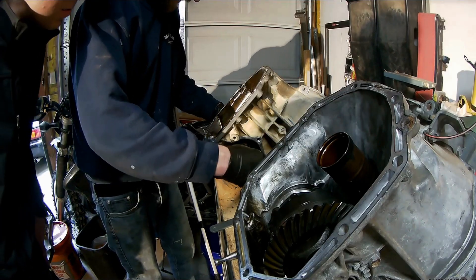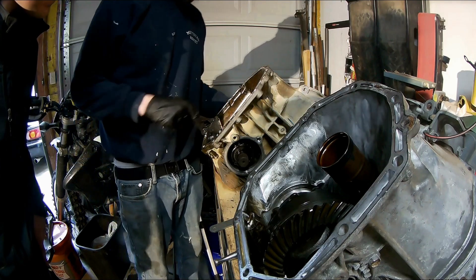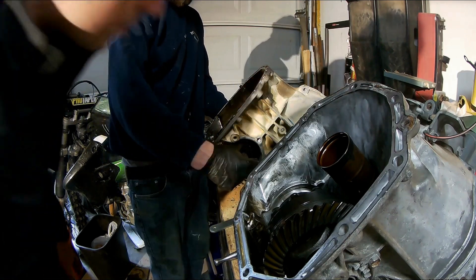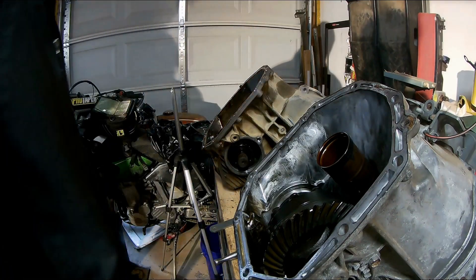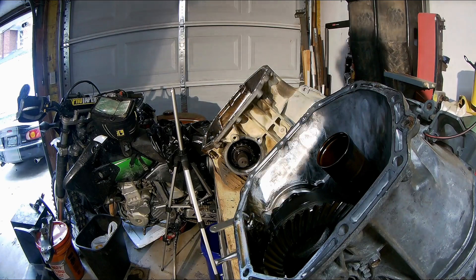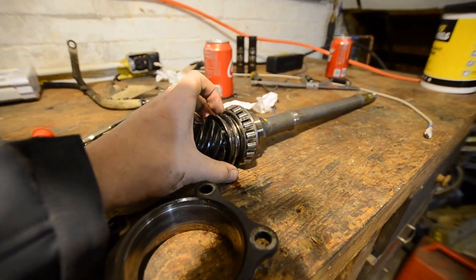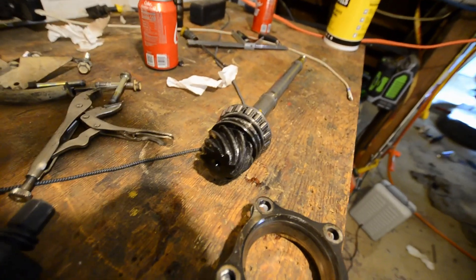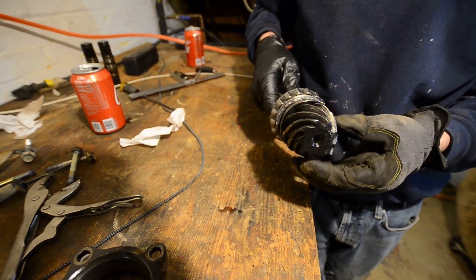Look at that - where did this come from? These are all intact; it must be the bearings for the pinion gear. I don't think there are bearings for the side gears - I think those are just... you can see if one of the rollers was missing, you'd see that it was missing - they're all there. We haven't looked at the pinion here. Oh yeah, that was the pinion alright. Because that pinion - if you look at the other one - they're lubricated by transmission fluid. It looks messed up, dude. Yeah it is. I wonder why that one particularly failed before all the other ones did. Might have something to do with the oil level.